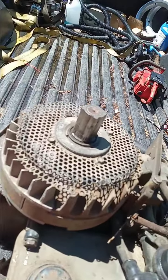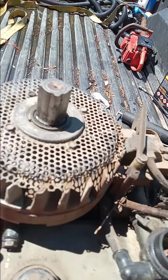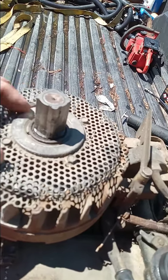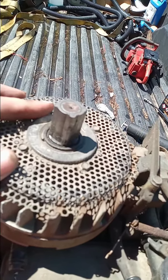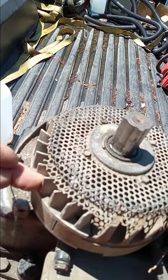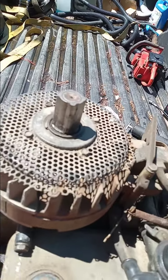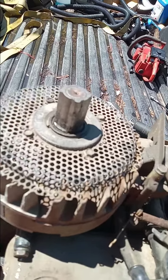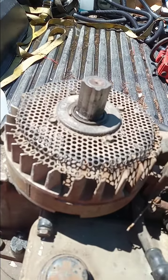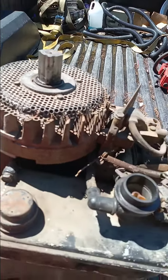Anyway, we've got to take this starter clutch off. And these bolts here will remove this fin cover. Then we'll grab this with a pair of channel locks or something and hold it, and put a little pry bar in here to hold the flywheel from moving and crack that loose and pull that off. Then there'll be a nut underneath here that we'll have to use an impact on. And then we'll take the flywheel off to access the points.